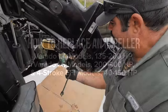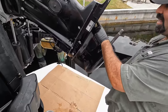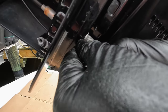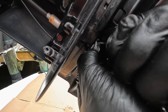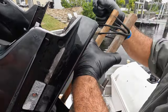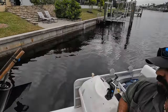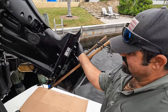This particular model has five bolts — the two outside and one tucked up underneath the anode that we removed. The washers are seated in there where it's really tough to get out, so make sure you grab the washers because they always tend to roll. With the bungee cords and broomstick setup, we're getting this bolt out of here, though I can tell the gear case is not going to fall right off.